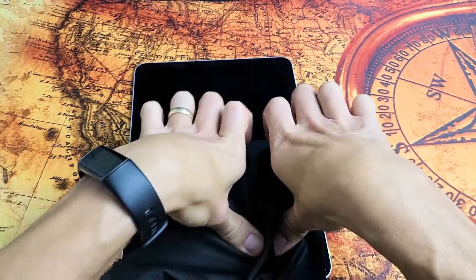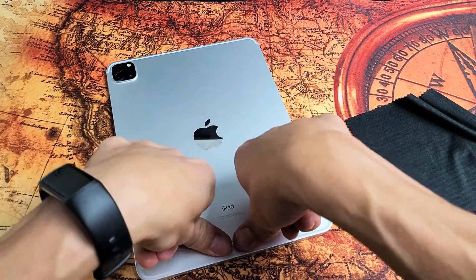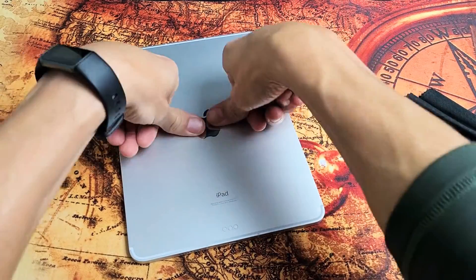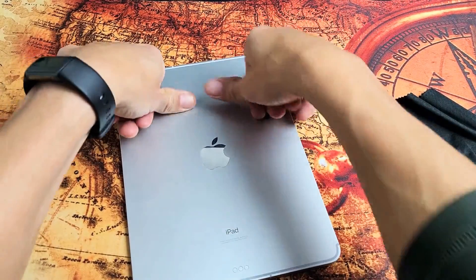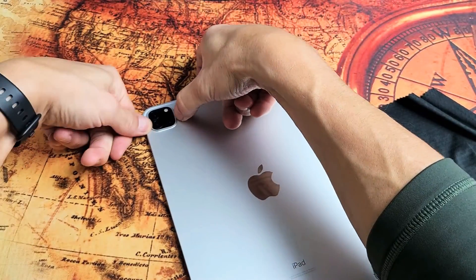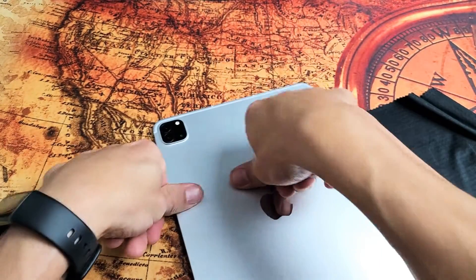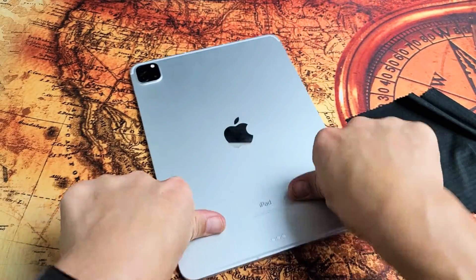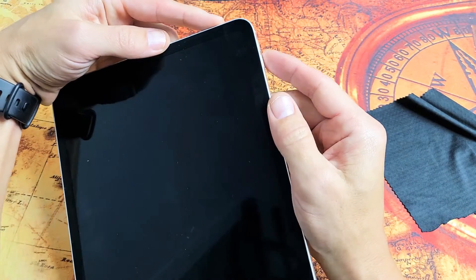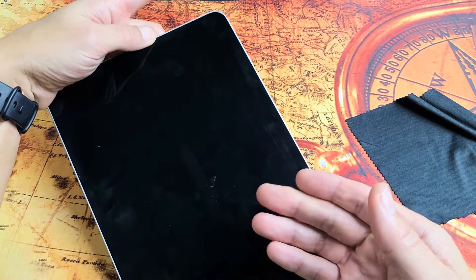Just keep pressing all over — same thing on the back. Press all over the back. If you hear a little click, turn it over and see if your iPad is on. Press all around, even around the edges of the lens, all over the back. Turn it over and see if your screen is on. If it's not, do the same thing to restart it: volume up, volume down, and then press and hold the power button and wait until the Apple logo appears, then let go. Once your iPad boots back up, hopefully you're up and running. If not, we'll go to the next possible step.